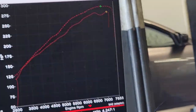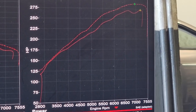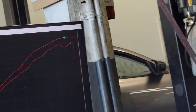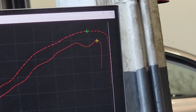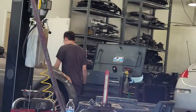That's it for this one. Obviously it's going to feel a big difference — 15 horsepower at the peak and then in the middle it looks like we have another 15 or 20 gains right there. This one definitely needed a tune. You can see over here where it used to drop — at about 6,800 to 7,000 RPM — and now it's just nice and smooth at the top.